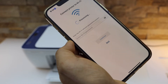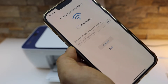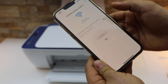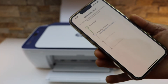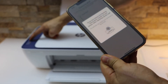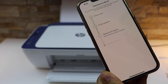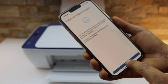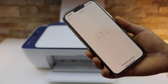It displays the names of the Wi-Fi networks — select your Wi-Fi network and enter its password, then click Continue. Now press the flashing information button on the printer screen and continue the setup process. Click Continue, then for installing cartridges and paper — we have already done that — so click Continue.